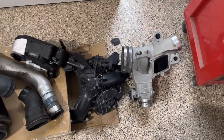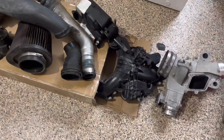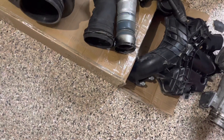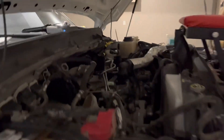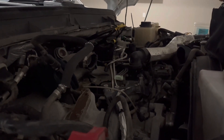Plus the car wash has got heated water. I just recently when I cleaned the engine used some purple power and it worked really good, so I'm probably going to soak them in purple power, power wash, do that a couple times. And I can just toss this filter for the CCV since mine is now deleted. So that's the next plan of attack — let them parts dry for a couple hours in here with the heat going while I mess with installing that line into the CP4 that comes with the kit.